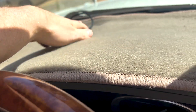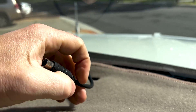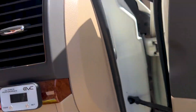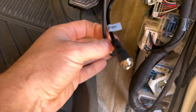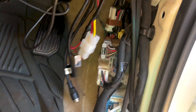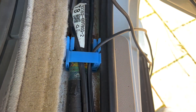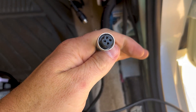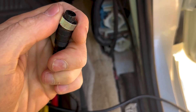If you had an old screen with your caravan reverse camera, you'll probably have a plug like this. If you follow this plug back, you can see it was tucked in and comes down here — it goes into two video inputs, video one and video two, both four-pin, plus power. If you always follow the cable back, you're pretty much always going to get to a four-pin plug. That is the actual caravan plug we're after.